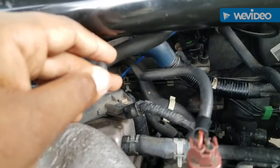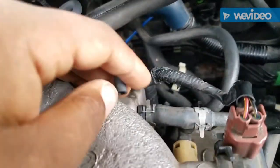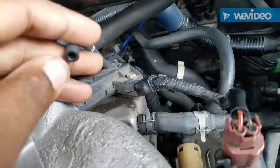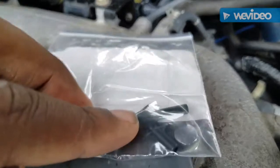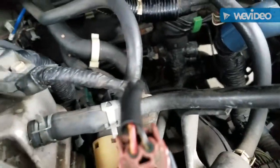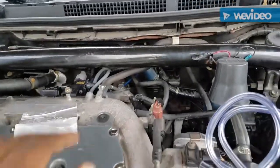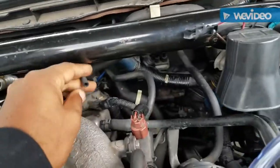Check and vac test your mounts, then vac test this main line from the top because it connects to all the others. If there's a leak, you need to find out which mount is leaking — front or back — and troubleshoot from there, since it all goes to a three-way valve in the back. What you can do is take the hose off the valve and put the suction on the valve for each engine mount to test which mount or hose is leaking.